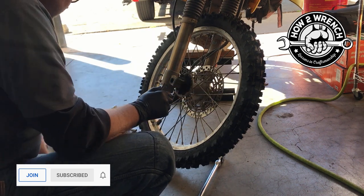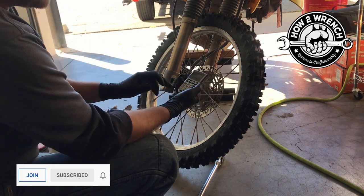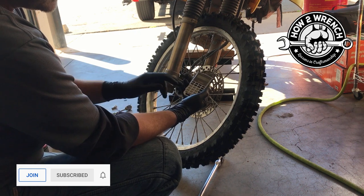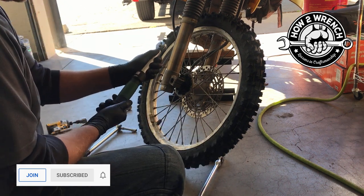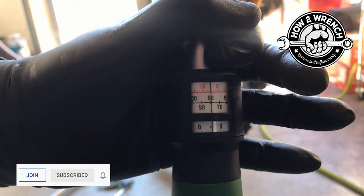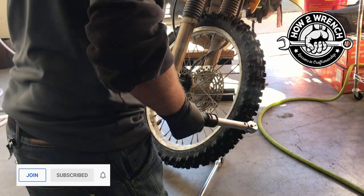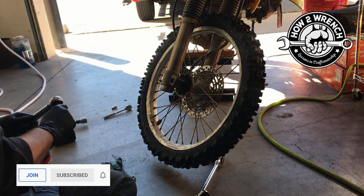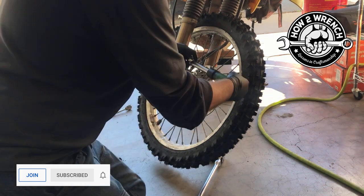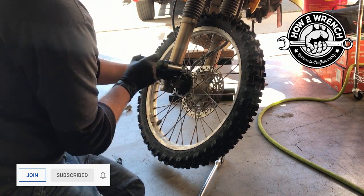That's why I'm grabbing two torque wrenches to accomplish this job. To convert 13 foot-pounds to inch-pounds: 13 times 12 equals 156 inch-pounds. I'll go ahead and set the small 3/8-drive wrench to that. The dial is really easy to read, and I like to start with what I call a half-torque or 'kiss' step — torquing slightly under spec first.